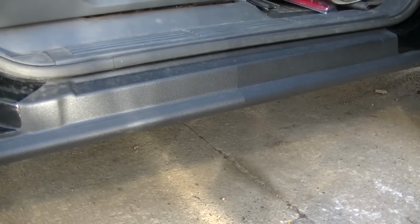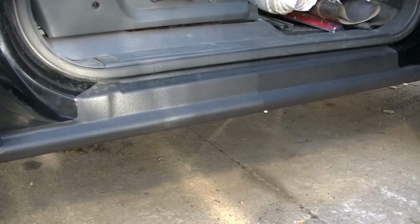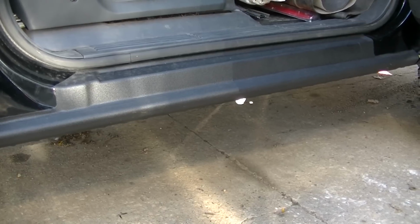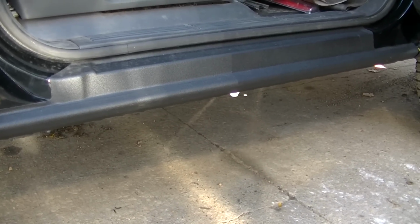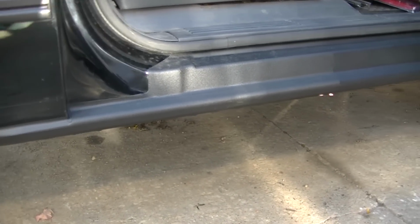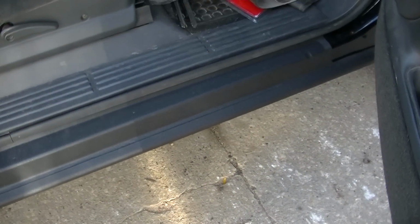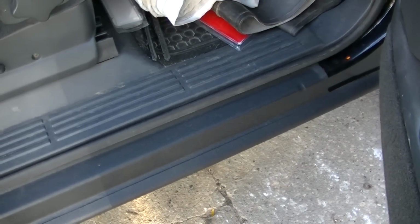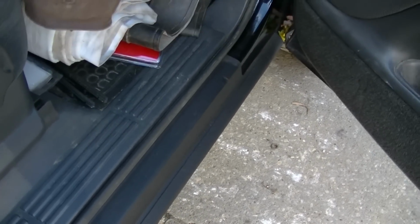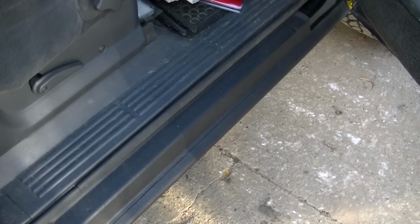So that's another tip here. And another thing is that guy wanted to make all of his patch panels. I would suggest you do not do that. They sell all these panels for not that bad a price, so I would not make my own panels. This is already a very difficult job as it is, cutting all this out, welding it in, seam sealing it, and then painting it. I mean it's one heck of a job. So I would suggest not making your own panels. That's just my suggestion. But I guess I'm done with these now. No more rusty rockers. I guess I'll see you guys in the next one.